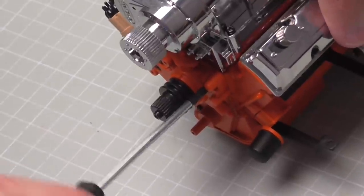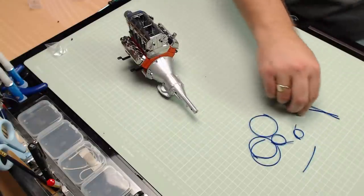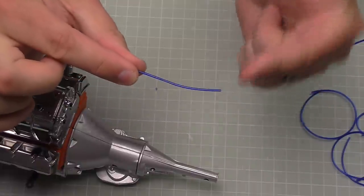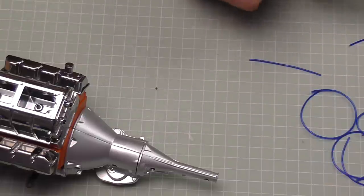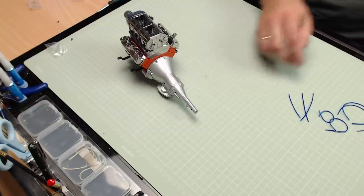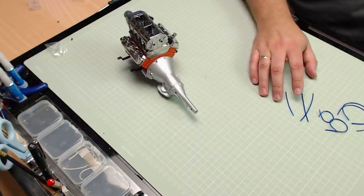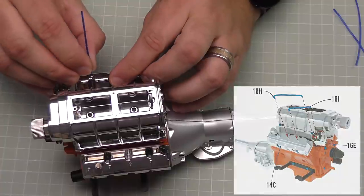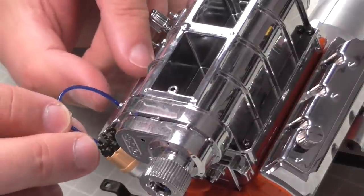Now we're going to start connecting the wires. A little tip: if you want to bend the wires around so you can route them, you can put some five-amp fuse wire down there and that will enable you to bend these where you like. I'm just going to put these in where they go for now. I've sorted them out into ascending order because they are all completely different sizes. The smallest wire is where we're going to start — that's just going to go into this side here over the top, and in the distributor it's going to go onto this bottom plug.